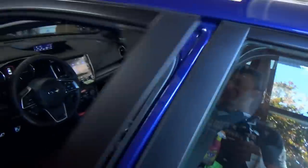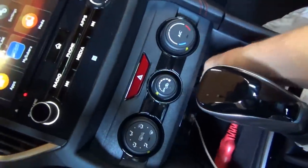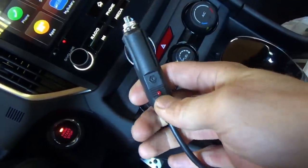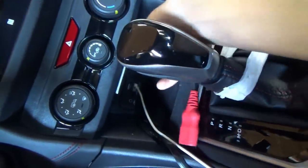Pressure's on. It's a 12-volt outlet — how hard can the circuit be? And it's kind of funny they say aftermarket stuff — what else do you plug into a 12-volt outlet? This is the outlet that doesn't work, right in the little front console. Quick check: plugging in the power probe adapter — if the LED does not light, this outlet is dead. Make sure you're in accessory mode.